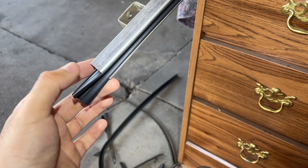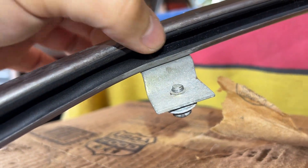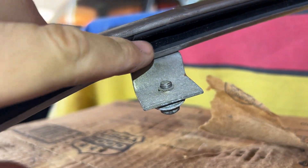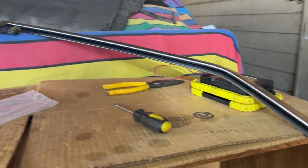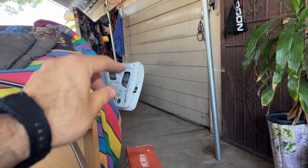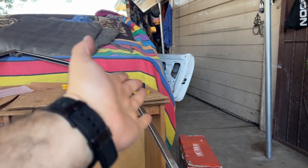There you go - a little excess piece here, but the point is that one piece meets up onto the other piece here. Just make sure it's there and tuck it all in. It's pretty much ready to install, but before we actually install this, we have to put the window regulator and the window inside first, because the window goes in from the top, and this also goes in from the top.